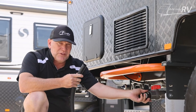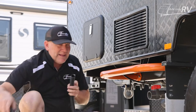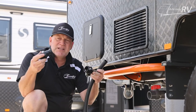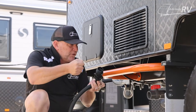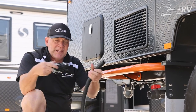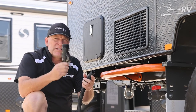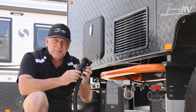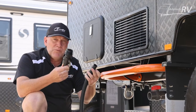The easier way of doing it would be to go a few rows over at Bunnings and get yourself what's called a cam lock system. A cam lock system essentially is a piece that just clips straight in and holds itself in place — so all you're ever doing is clipping it on and clipping it off. And if you're very clever, you get the other end as well, so when you wind your hose up they can clip into each other and your hose won't be open and leaking water through your van. The Azuto brand has stainless steel and bright orange ones that you can use as well — go and check them out.